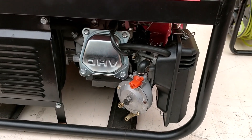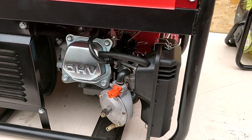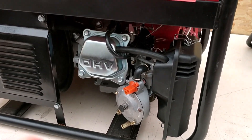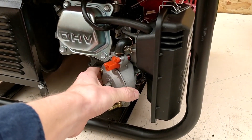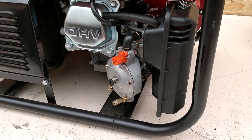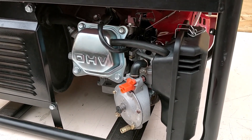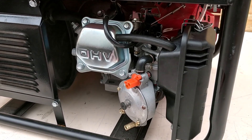So what I've done instead is gone out and bought a 150 bar hydrogen tank — pure hydrogen — and that's going to be running this carburetor here. It's an LPG carburetor that's been converted to run on hydrogen gas, done by changing the fueling ratios and altering how the butterfly valves work with the choke and all that.